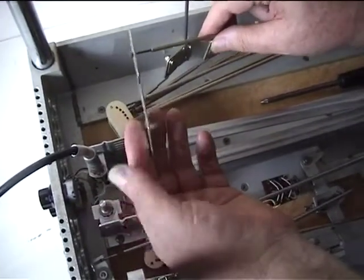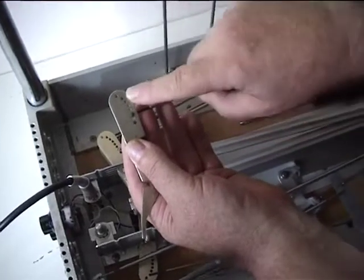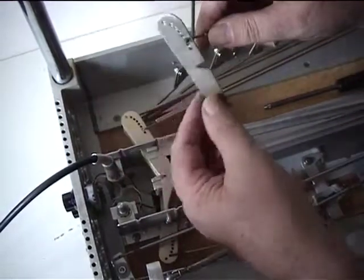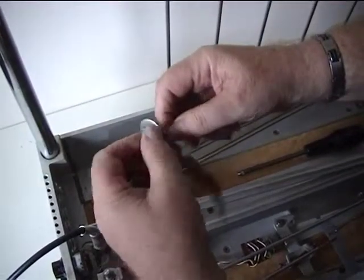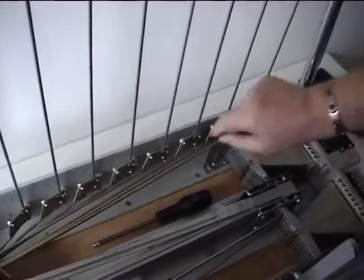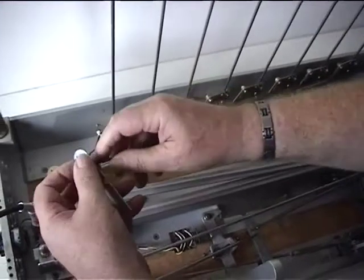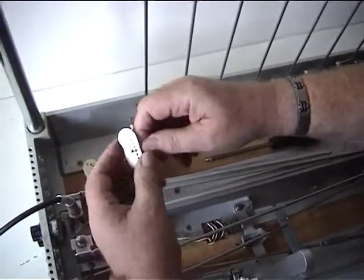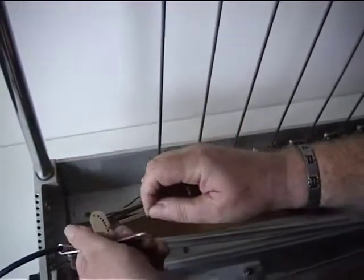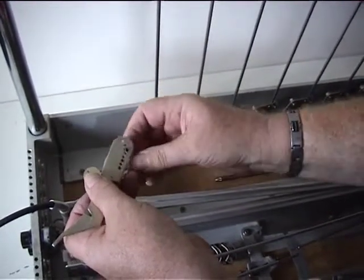We get this part out. Now we want to change the leverage — remembering the orientation of this part — to have a longer pull with less tension. So we move out this way, and it's just a case of unscrewing this without turning the rod, because if you turn the rod here it'll tighten up there and change the length. What we're doing is unscrewing this section and changing the leverage point to maybe there, so we've got more travel on the pedal but less pull, less tension.